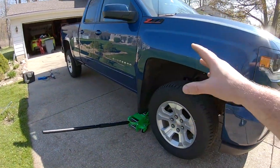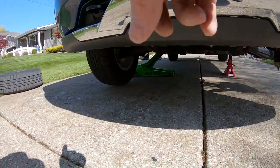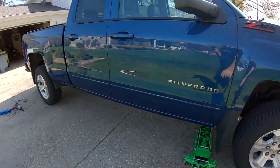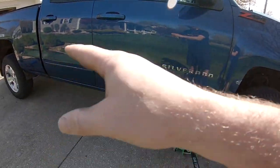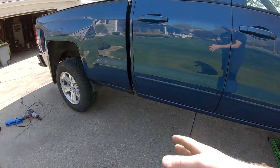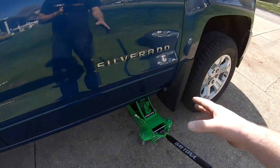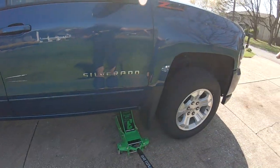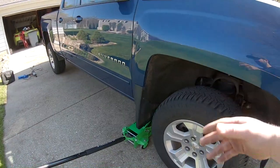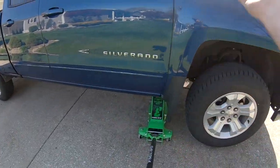I know many of you guys might watch this and say, you should have just jacked it up on all fours. I was thinking about doing one jack on each side of the front, getting the whole front off the ground, then doing the rear diff like I did, having all four off the ground, but it just seemed kind of sketchy to me, and I figured this one wheel at a time version was a little bit safer. If you're not on a completely flat surface and you have the truck off the ground completely, and then your jack decides to start to roll, which my driveway is pretty flat, but if it just so happened to start to roll forward, you're gonna have a wheelless machine starting to coast down your driveway until the jack slipped out, and then the whole truck would be on the ground, I guess. So I'm just being safe and doing it this one tire at a time deal. Let me know in the comments what you think, if I'm doing this appropriately.